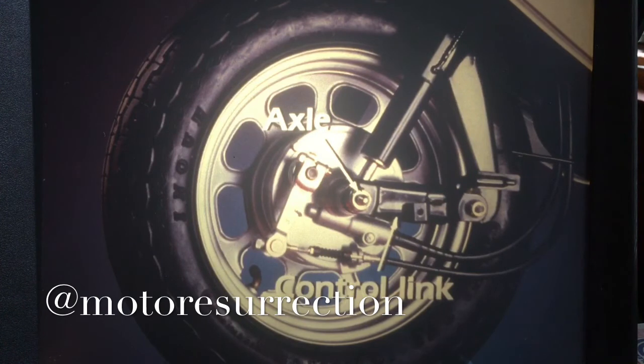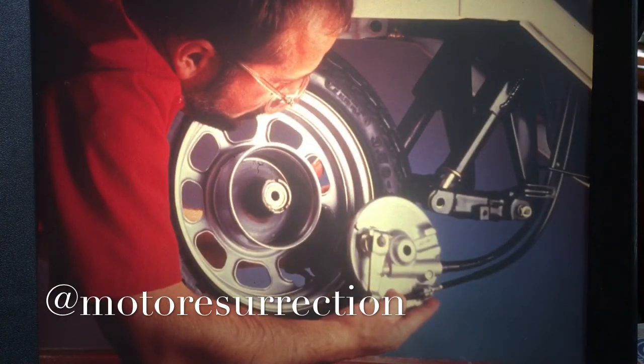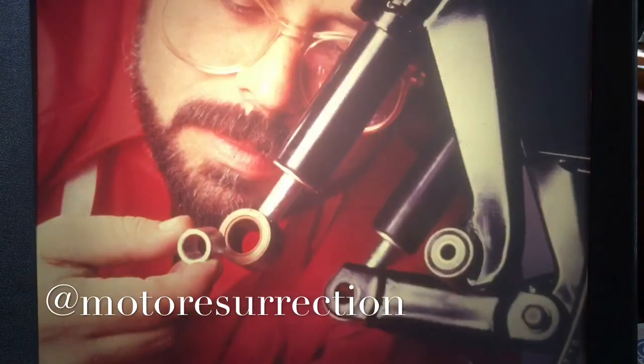Now let's look at the CH80's front suspension. It's a leading link design, which means the axle leads or is located ahead of its control link. After you remove the wheel from the pivot arm, you can get to the bushings. Inspect them according to the shop manual procedure, and when reinstalling them, grease them and use new O-rings.